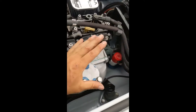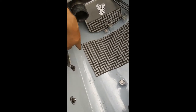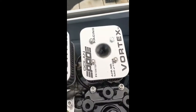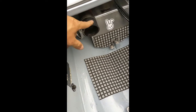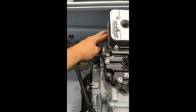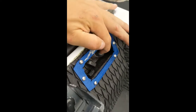And once that's all good together, I'll be putting together my B pipe, which hooks into here. I'm going to have a tube going from here to here. And lastly, the fuel tank will hook into here and get placed right here. And you'll hook your fuel lines up to the carb and to your primer if you're going to be running a primer.